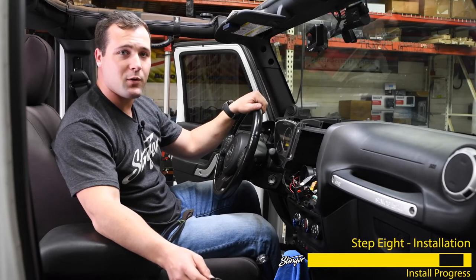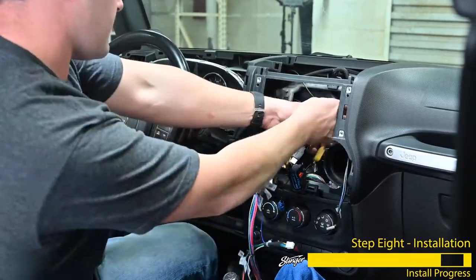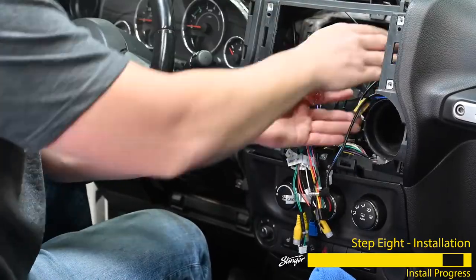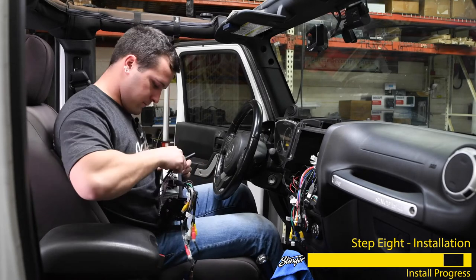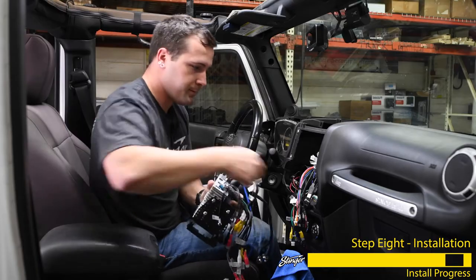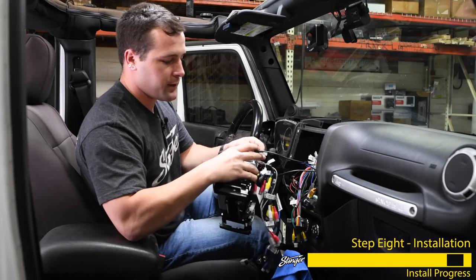Now we're going to install the wiring harness that we previously prepped over on the bench. Tuck the module into a cavity behind the radio as well. We also need to connect the antenna adapter that came with your kit — that'll plug into the white connector here. Now we're ready to plug in all remaining harnesses into the radio brain. Starting with the antenna adapter, we want to make sure to uncap the steering wheel control output adapter and connect it to the port labeled SWI.